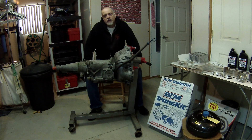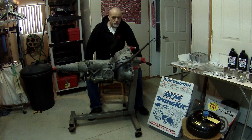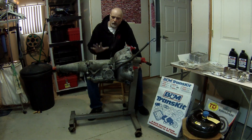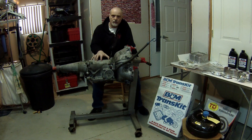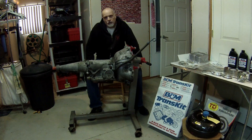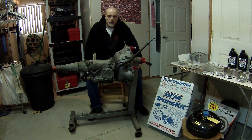As I was putting my parts together, the thing I learned I had to pay attention to was the bell housing, the flywheel, and its bolt pattern. The internals were the same from year to year. Along the way you'll see that I'll be prepping this with a performance package and a shift kit.